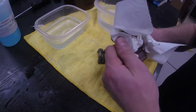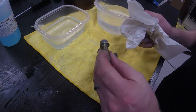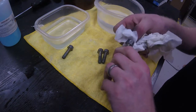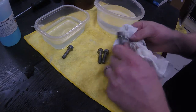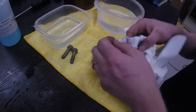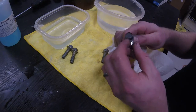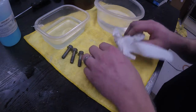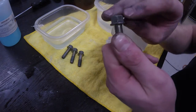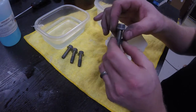Getting back to my workstation, you can see the results from the carb cleaner - a very clean bolt in very nice shape. Basically what I've been doing is just drying these off; you can use an air compressor, I normally do. I'm checking the condition, and if there are areas that are still worn or still have some debris, I'll just quickly take a pick or red scotch bright, just a maroon scotch bright, to scuff up that area and remove any oxidization or dirt or staining on the bolt. For example, this one right here you can still see there's still a little bit of residue, so I'll hit that real quick with scotch bright before putting it in the boiling TSP solution.